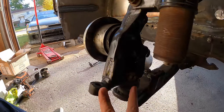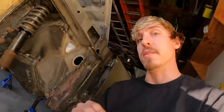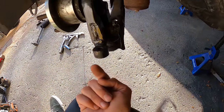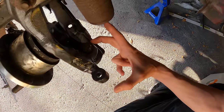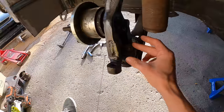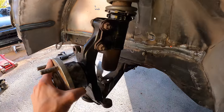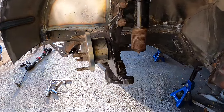As for the tie rod mount, you can see how close it is to the ball joint. The stock unmodded knuckle has the tie rod mount much further away. Decreasing the distance between the lower ball joint and the tie rod mount adds angle - so this is what you'd call a drop knuckle with a modded tie rod mount. It's good for angle and steering geometry. Running a modded knuckle on an S13 requires an additional step: rack relocation.